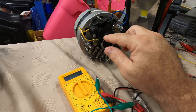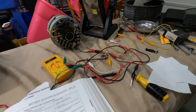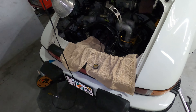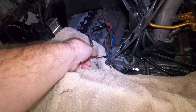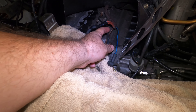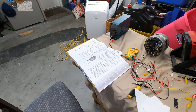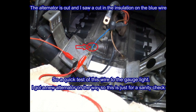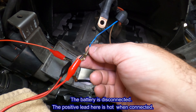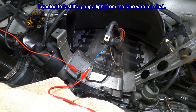Spoiler alert: it's somewhere in these diodes, I think. I'm not an expert, but from what I could tell the car wiring is all fine. I did go in and taped up some of these connections as a preventative measure - I added a little more tape, taped around the blue wire. If this was causing a short right here, it was shorting against the alternator - the diodes on the back are kind of sharp. So maybe that's where it was shorting, but I don't know if that's a real smoking gun. It's the only thing I can find so far.